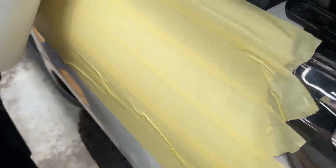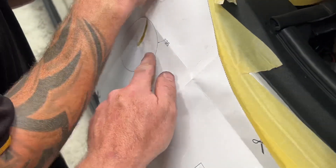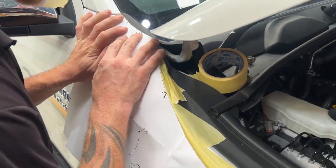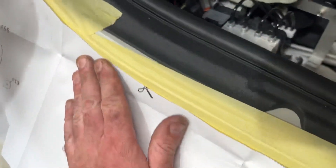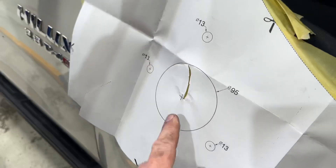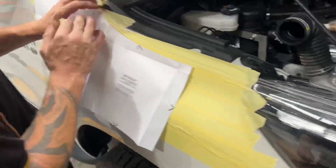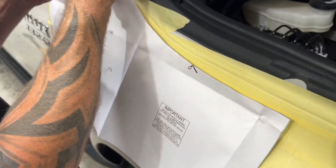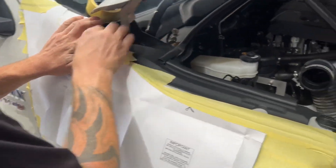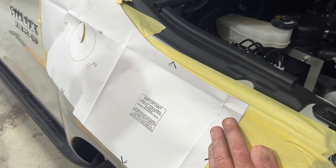Josh is masked up underneath to help with any fingerprints, scratches, or cutting swarf. Once we get the hole cut out here, we mark on the masking tape — not on the car. TJM has given you a proper little cutout which you follow along the dotted lines, following the line of the guard. Then you have holes to drill for mounting and a hole for the snorkel to go through. There's also another cutting hole inside which connects everything up. It's pretty straightforward — follow the dotted line down the arch of the grille and guard, mask it up, mark your holes, good to go.